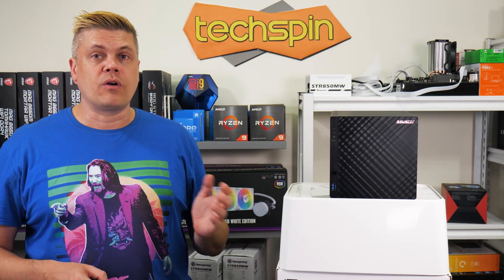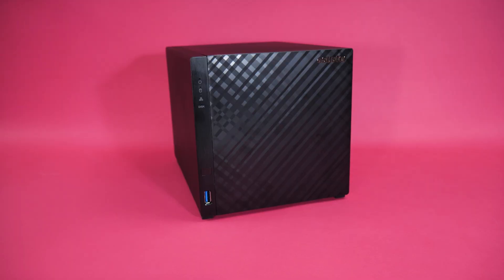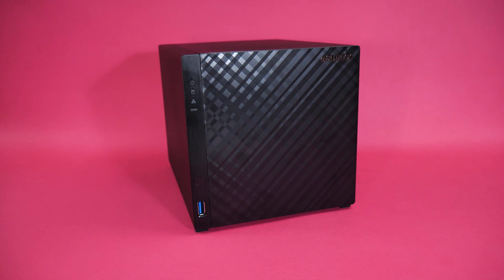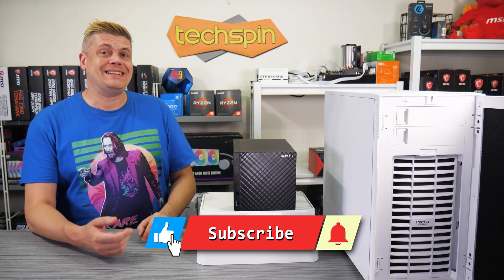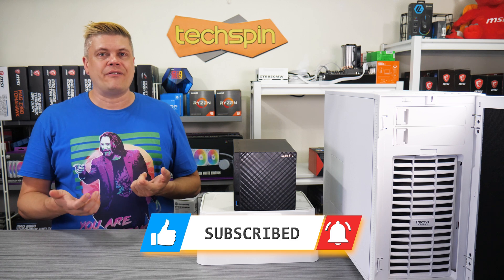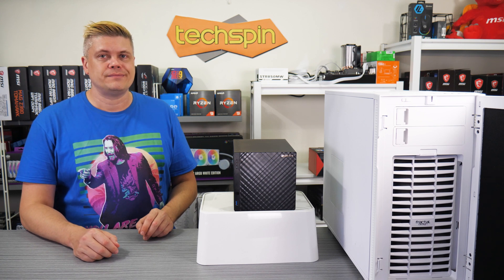You may be looking at this DriveStore 4 just for file storage, but what functions do you really need? If you need the basics with remote access and 4K media streaming, the DriveStore 4 is optimized for this and you definitely save yourself the headache, time, and money on your power bill over a DIY. For me, I spent a month researching, sourcing parts, assembling, testing, and troubleshooting my DIY NAS — with an AMD CPU and Unraid there was a learning curve, the CPU didn't have onboard graphics, didn't play well at first, and Unraid sometimes glitched and I've been in the settings menus way too much.